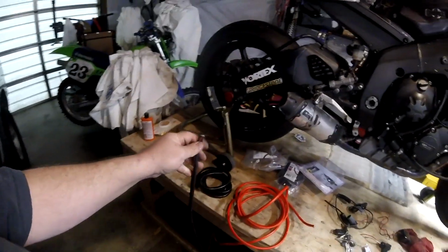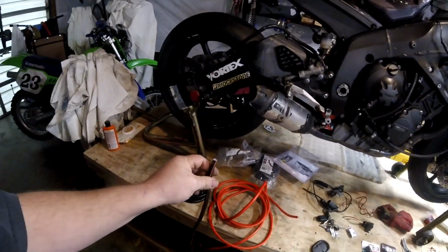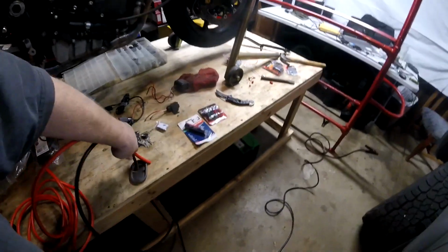And this rusted old Toyota, because it looks nice on the outside, that's why I bought it, but it's rusted underneath. If that rusted frame is not well grounded, which it should be, I'll run additional grounds from the frame back up to the battery. I'll make the ground better. But for now, to get the battery system working, I'm going to run this heavy, thick 4-gauge ground right alongside the feed, and they're going to go through this.